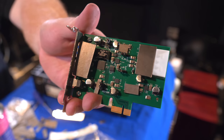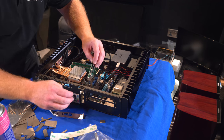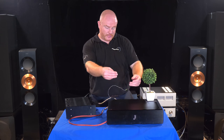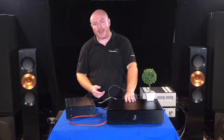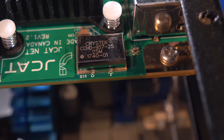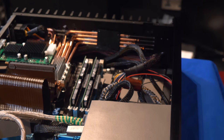The other fiddly thing was installing our cards — we've got our JCAT USB Femto card. It comes with two headers, and I found it easier not to put the header on as it was just too tight to fit in the chassis. I took the faceplate off, installed the card, then put the faceplate in and screwed the top one. Then I installed the JCAT Net Femto card up high, and used an HD-Plex riser cable to connect to it — a really floppy cable, but I was able to bend it up and over quite neatly. After that, I ran more of the 3M AB5100S around pretty much everywhere to cover as much as I can.